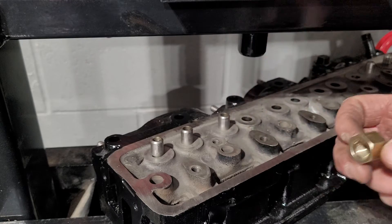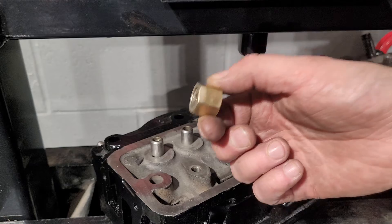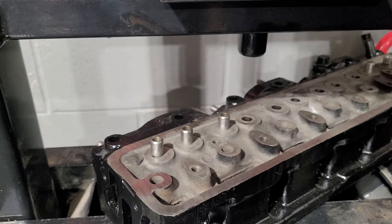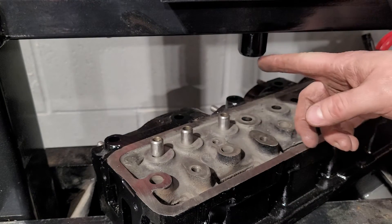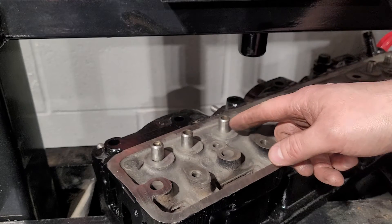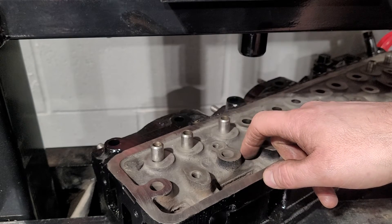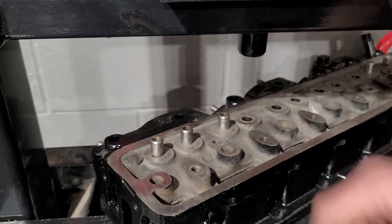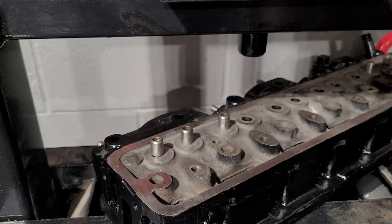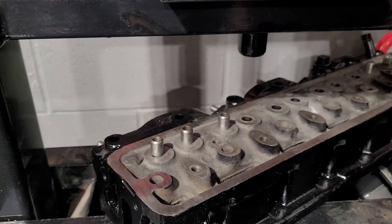So that's my tip and what you need. Go to Home Depot, buy one of these brass pipe caps — I think it's like three dollars — and that will set you up for your guides to put them back in. And that's pretty much it. It's not complicated, it's not hard. Obviously having a press makes it easy. If you don't have one, maybe your machine shop will take them out if you're going to get them machined — they'll take them out for you. All you have to worry about is putting them back in. You shouldn't need that much pressure putting them back in as long as your port is free. Thanks for watching. Any comments, questions, or anything like that, by all means leave them. Drop me a message, get in contact with me. If you like it, hit the like button and hit the subscribe button if you like all the other videos.